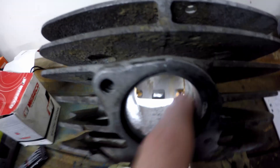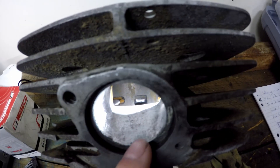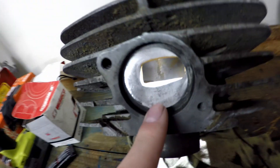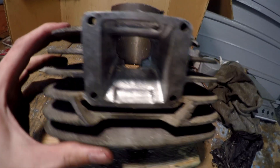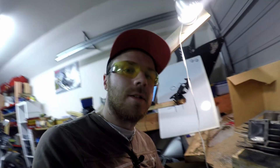This is what our exhaust looks like after dremeling — it's nice and smooth. Now we're going to move on to the transfers, and then we'll polish the intake. This one will get polished as well but I'll do that off camera. I've just quickly cleaned up the transfers so the entrances are nice and clean. Our intake is looking super sharp right now, and we're going to grab some sandpaper and start sanding.